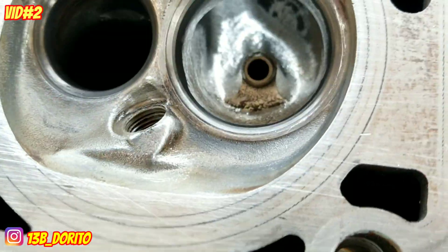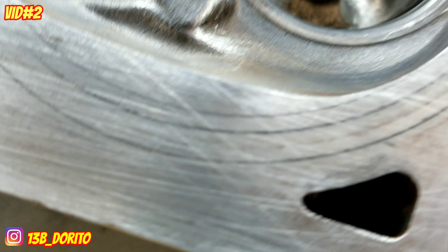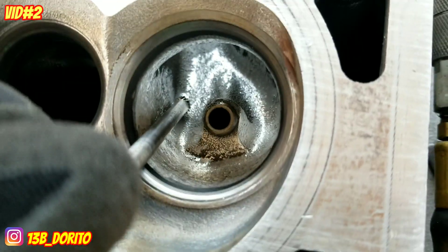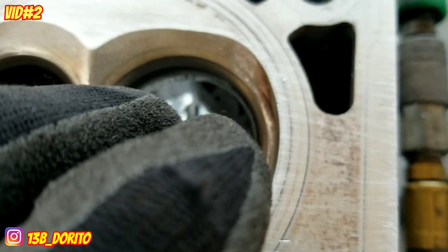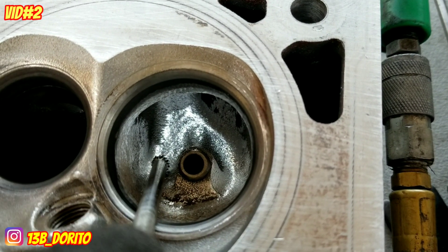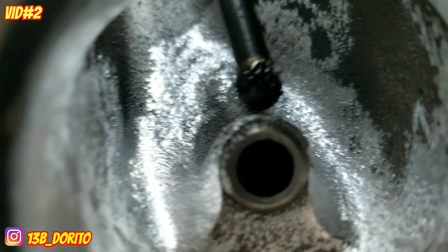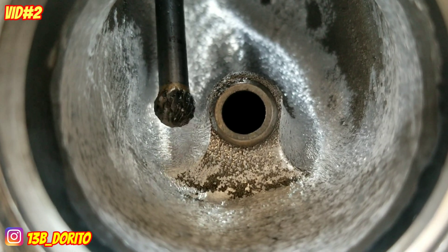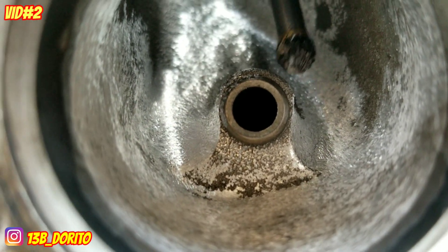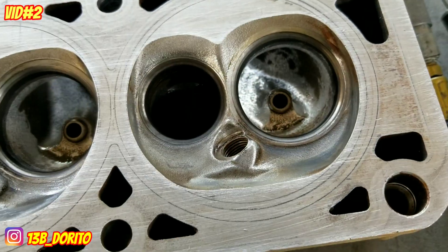What I'm cutting is what I call making a heart. I use the diamond bit — egg shape — and you go down from here all the way up, from here all the way up, making a backwards heart shape. You focus on this point level as your guide right here, and you flush it — the valve on the aluminum — all the way around. All this extra meat right here has to be gone.